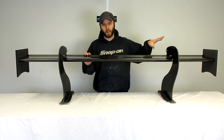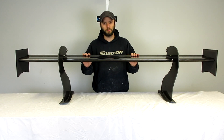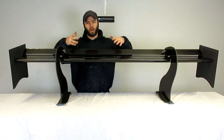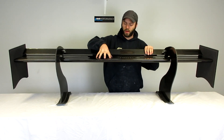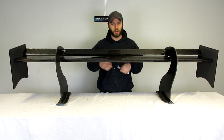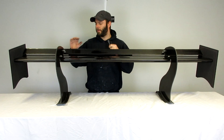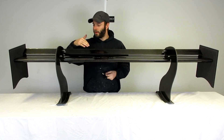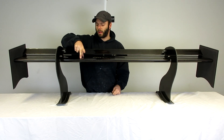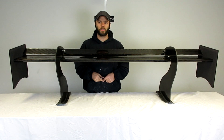We're going to do a quick end plate swap, add the upper element, and then we'll take a look at the Apex 12. Simply swapping the end plates and adding the upper flap, all of a sudden you have a dual element wing which provides a lot more downforce and is also a very efficient wing profile. To adjust it, all you need is a 10 millimeter wrench and a 4 millimeter Allen. Loosen up your adjustment points and change the angle of the upper flap. To adjust a dual element wing, you don't necessarily want to change the angle of the main element — it's the upper flap that gets the adjustment to increase or decrease downforce to keep that aero balance correct on your car.